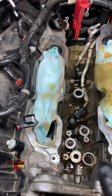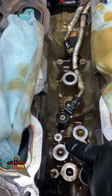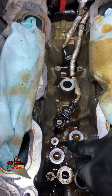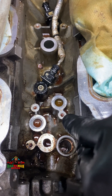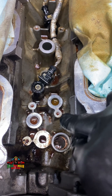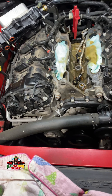Do not just put this on here and start threading the bolts in, thinking that the bolt is going to displace the coolant out of the hole. Some of it will spill, but some coolant will get trapped. Liquids do not compress, and as you tighten this more, it adds pressure to the aluminum housing — the casting — and it will crack the block. Crazy, right?